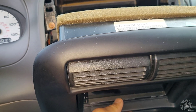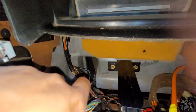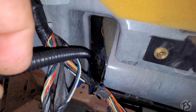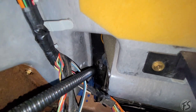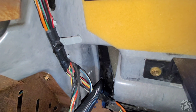I went ahead and unplugged everything. That's where I ran the RCA — you can see it's shooting through down right there, and it's zip tied to a harness down there. This one's going to be zip tied right here so it's away from the actuator for the AC or blower motor. Added a little bit of loom just to help protect it from the metal right here so it doesn't rub on the actual RCA. Go ahead and zip tie everything and then we'll keep moving.